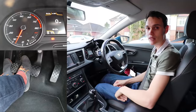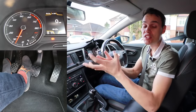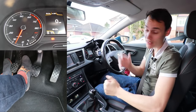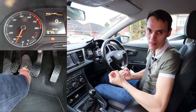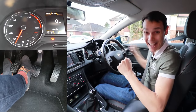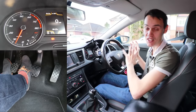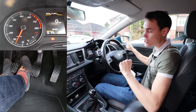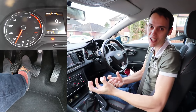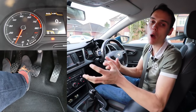In both those examples I held the clutch quite low on the bite point so it would slip for longer and you could see the demonstration better. Normally I'd hold the clutch a bit higher - it won't slip for as long and I'll accelerate more quickly. The higher you hold the clutch, the less time you need to hold it there and the quicker you accelerate, however if you hold it too high you get that jerk. Also, the more gas you give the longer you've got to hold the clutch at the bite point, because the clutch has to spin faster before it can match the engine. So it's a combination - balancing between the two.